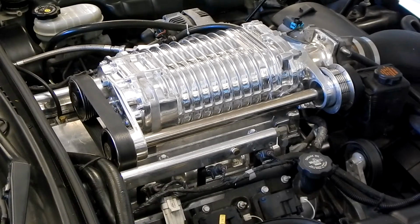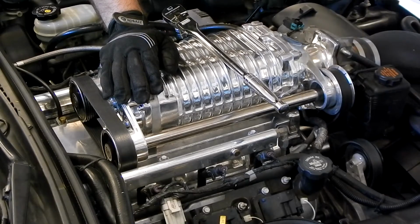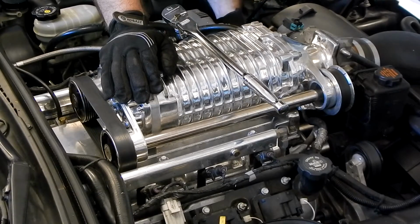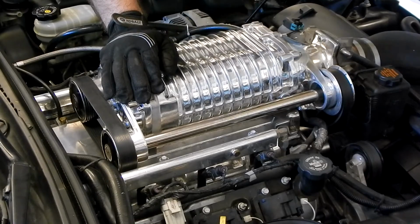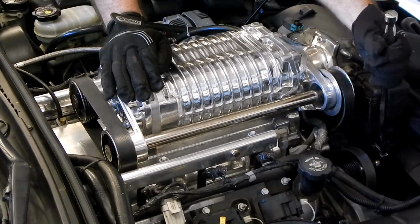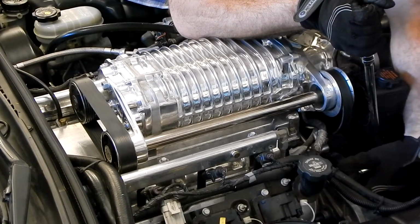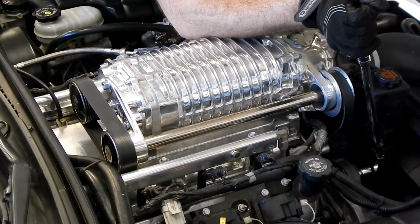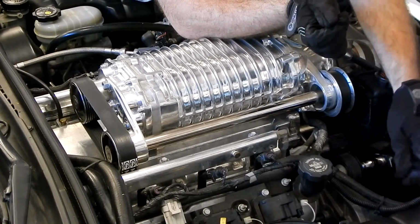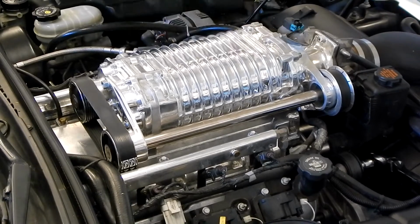Before we set our final tension, we're going to go ahead and put our serpentine belt back on. So before we do the alternator pulley, I'm just going to put this up here, and then I'm going to check on the bottom, make sure we haven't slipped off anything else. No, I'm looking okay. All right, so at this stage, I'm going to mount our bar and then pull that down. Pull in our slack, making sure we don't slide off any of the other pulleys. Pull back around our alternator and let it go. And then just real quick, I'm going to do a visual inspection. Make sure we haven't slipped off any of the pulleys.